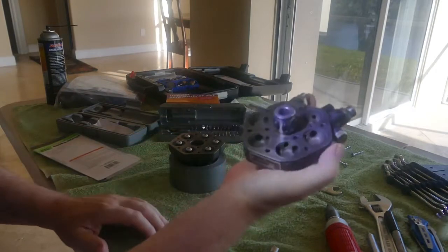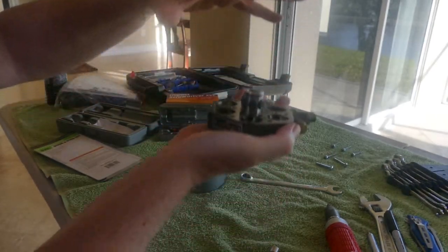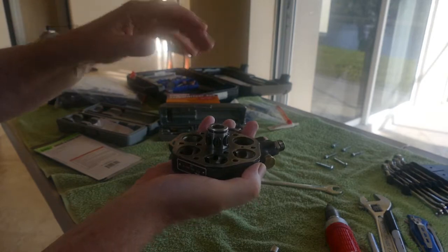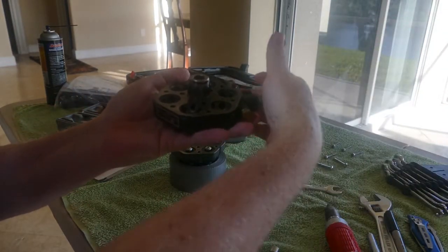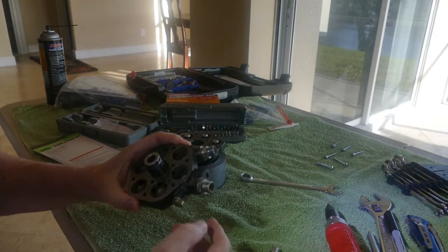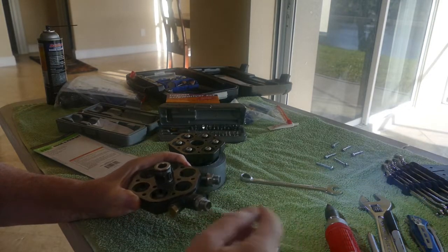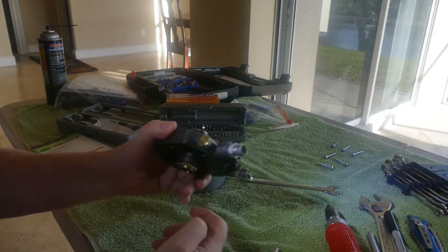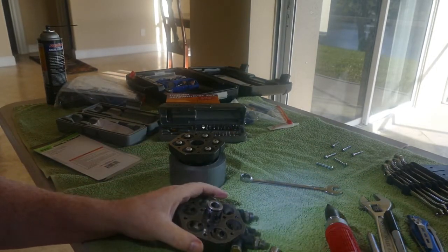This is towards the back of the motor, so you can't test it unless you put it all the way together and raise the engine back into place — and once it's like that you can't see any of this. I could smell fuel though, and if I reached my hand around I could feel that fuel was leaking underneath. I thought it was one of these connections or the hose, but I slowly came to the realization it was leaking out the bottom here.